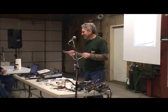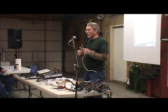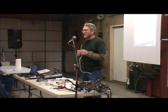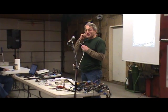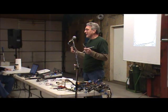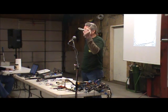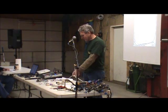The problem here is that the insulation on this is made for an environment that's relatively constant. I mean, the temperature change in your house is probably only about plus or minus 30 degrees. Humidity is relatively constant, and the lamp just sits on the table. Now, I'm sure my Mini will tell you that it got down to 0 a couple times this winter. And I park it buttoned up in the parking lot, and I'm sure it could get over 120 during the daytime in the summer. The insulation on this wire is not made for those kinds of temperature extremes, and it will fail eventually. And that's why you don't use this.